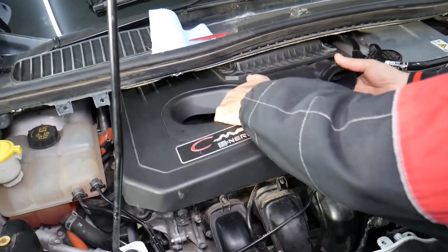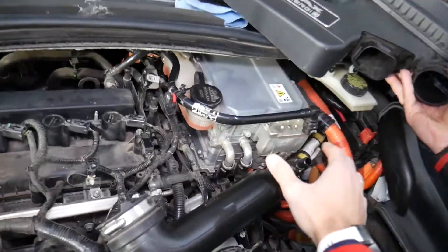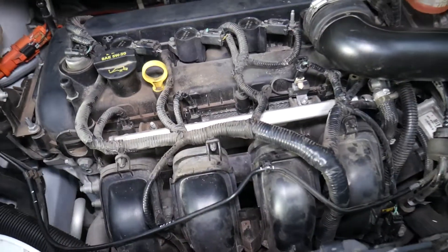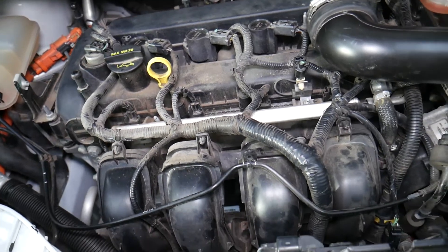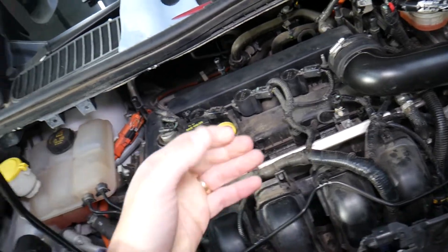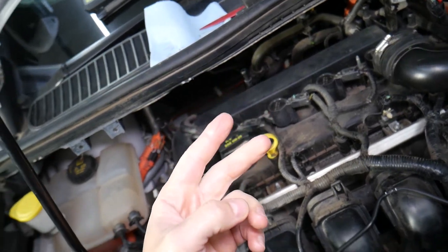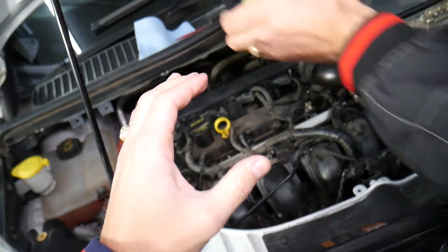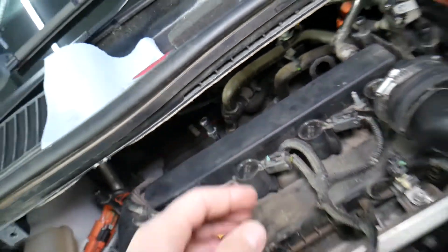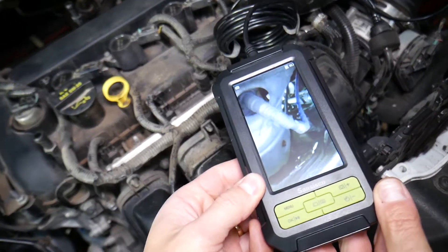On the hybrid, the transmission and DC-AC inverter are located on the right side of the engine, but right here is your engine — a regular engine, nothing special. Code P0171 usually indicates lean fuel mixture. You have two oxygen sensors, and the first one is located right before the catalytic converter on the exhaust system — that's known as the upstream oxygen sensor.